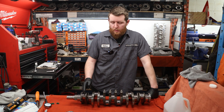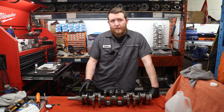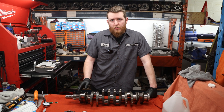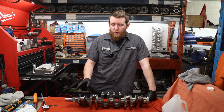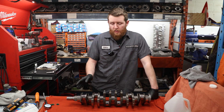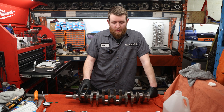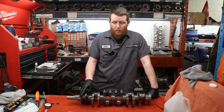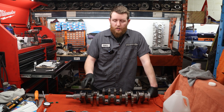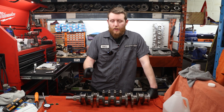We've measured our journals and oil clearances. This is a standard crank that has been polished — typically we end up with a slight variance in journal size on a polished crank, still under two ten-thousandths of an inch variance. We're right under the two-and-a-half thou, so two-tenths variance across all six, but it is a good acceptable clearance. We've already matched our rods to the journals, so now we'll set that aside and check piston-to-wall clearance, then start assembling and gap our rings.